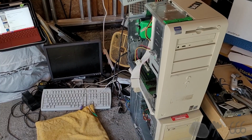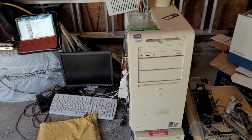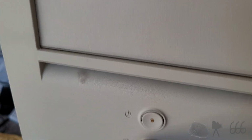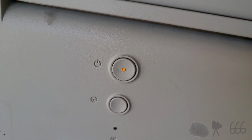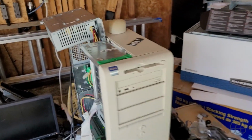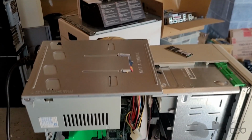Well, that's a bust. Complete bust. Tried removing the RAM, tried pulling everything else, still does not give me any reaction, and even though I got a green power LED now, if I hit reset, turns amber, never goes back to green, and, well, nothing happens. So, I think that it's a safe bet that the power supply is bad.